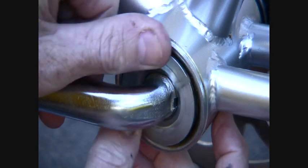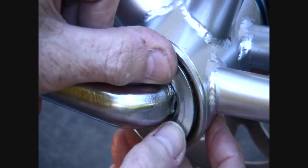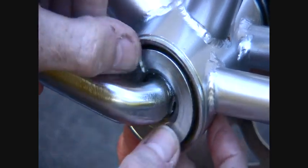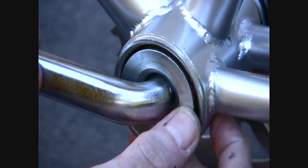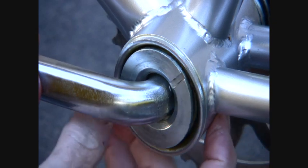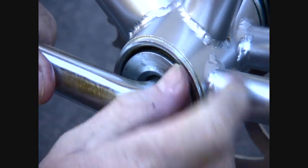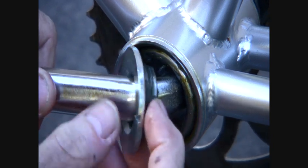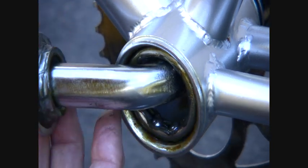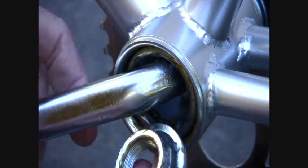This is the old-fashioned type of bottom bracket and a one-piece forged crank. It's heavy, but it's rock solid — it's the strongest type of crank. It would never fatigue and break on you, like aluminum cranks are sometimes known to do for riders who stand on the pedals. Here comes the cone. It looks pretty clean to me, but microscopically speaking, this stuff is not clean.